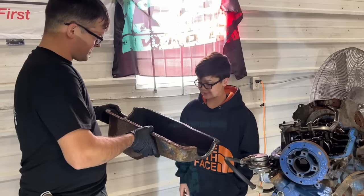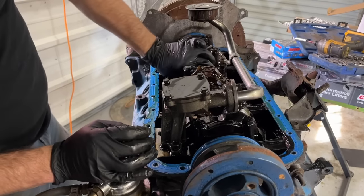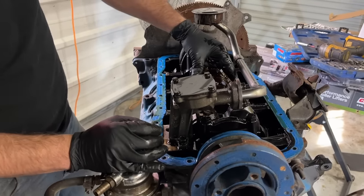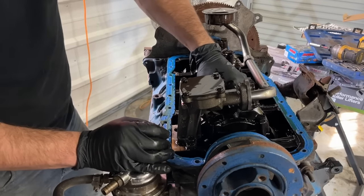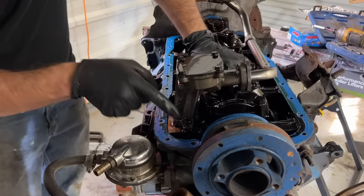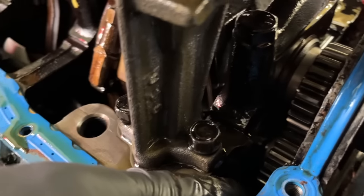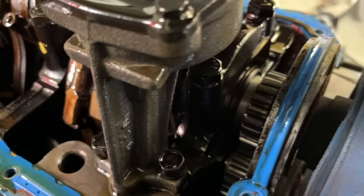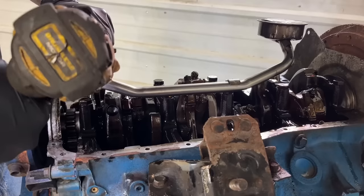Right? Yeah. So just a really super basic inspection is wiggling the rods back and forth on the journal. If you have an engine that's knocking, the rod will wiggle on the crank journal. All those are not knocking. This has a gear drive. Look down in there. It's got a gear drive already. Oh, that's cool. Yeah, this pickup is no good to us now.